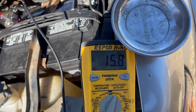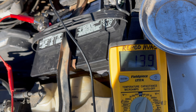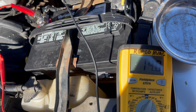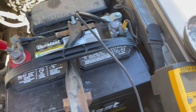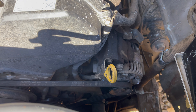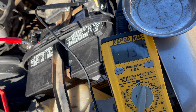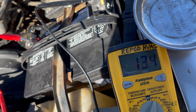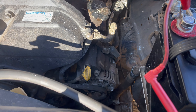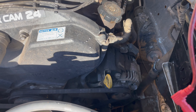Actually it doesn't seem right, I'm going to shut it off. This battery is brand new, so I'm guessing that's why they took it to AutoZone — they put it on a computer and it said the alternator had failed. I was expecting more like 12 volts and then nothing when started, but it was showing 15 and now it's on 13. Maybe it's just bad but still functioning sort of. Either way, I'm going to pull it out.